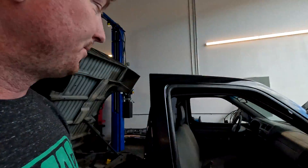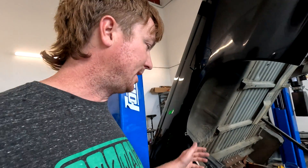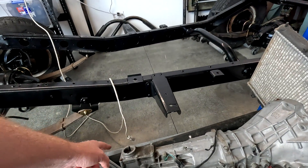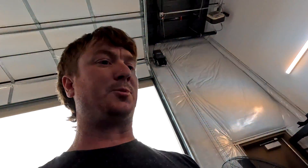It's just a tilt bed for the battery access. We're going to add some pneumatic struts to just help lift it — not to actually make it a dump truck. I don't think we have the ability to do that without a hydraulic system and hydraulic rams, and that's out of the question for Dave's goals. I started putting it back together — I got the mirrors on, got the taillights installed, cleaned it up. So now we're ready to get that Nissan Leaf in here, take it all apart, and put it in this truck. We also got the motor adapters ordered from Bratt Industries, so hopefully they'll be here in another week or so — just to mate to the bell housing of the manual transmission. We do need to get a shifter, and we're going to have to come up with some custom mounts to hold the whole drivetrain in the vehicle.